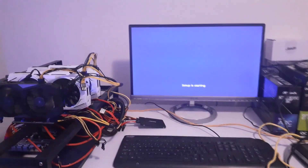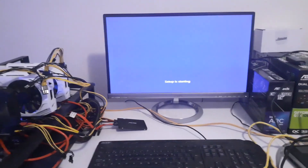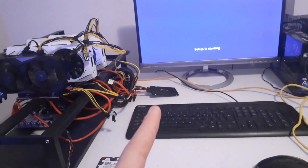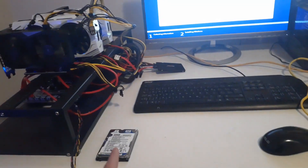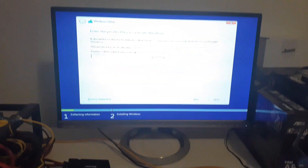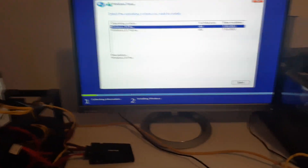It's good that it can detect Windows setup now, so we know the boot is working. Now we just need to find a hard drive. I'm checking if it detects the SSD; if not, I'll plug in the 320GB standard rotation drive. I'll skip the product key and select Windows 10 Pro.